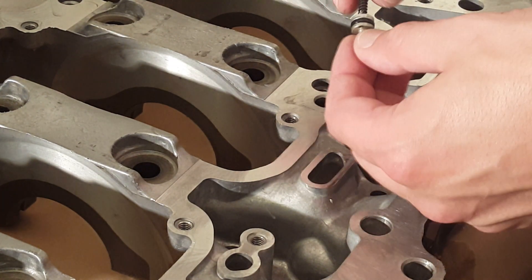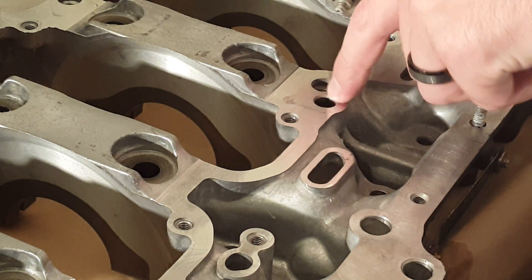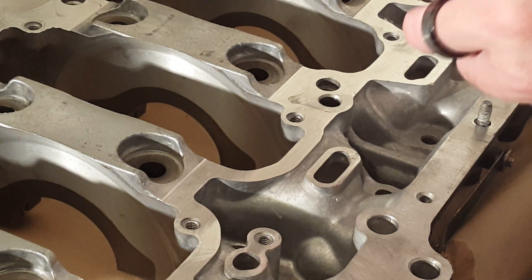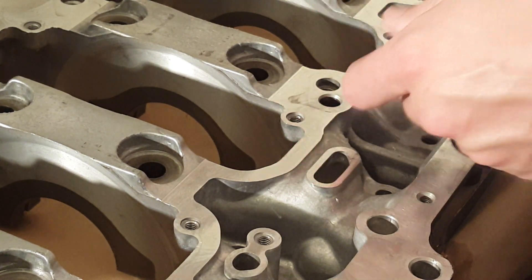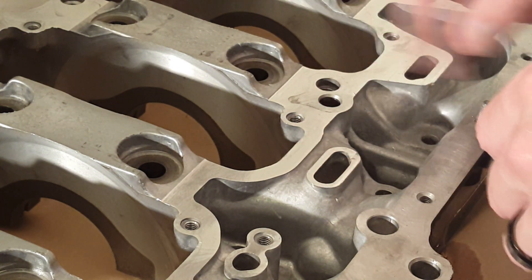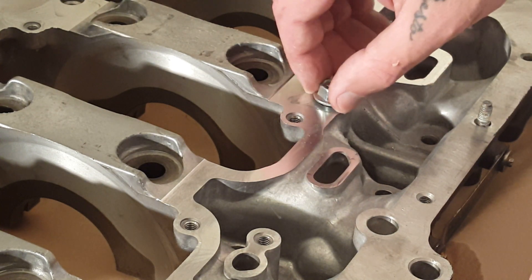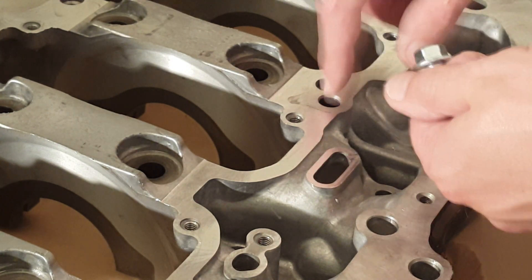Here is the little plug that I pulled out. It's got a little O-ring on it, a little hole in the bottom. I'm guessing you could actually punch it out from the other side — it appears you can, as long as you get it right dead in the center. I kind of got off center with mine, so I just had to put the screw in the top and pop it out. My luck, I do not have threads in here, so I will have to tap that hole. This is the bolt — it doesn't look like it gets a whole lot of thread contact once it gets in there, but I'm going to figure out the thread pitch and then tap the hole.